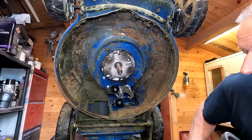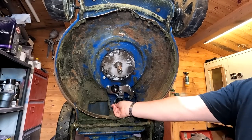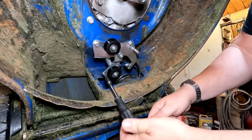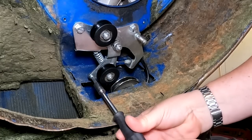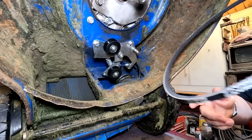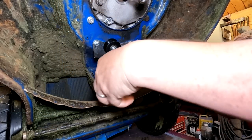So let's try and get this belt back on, but I think we need to take off this little bolt there which looks like a 10mm, because the belt actually goes behind there. So we'll just undo that — it's like a belt securing bolt. I think we need to be sticking the belt through the back there, around the pulley.